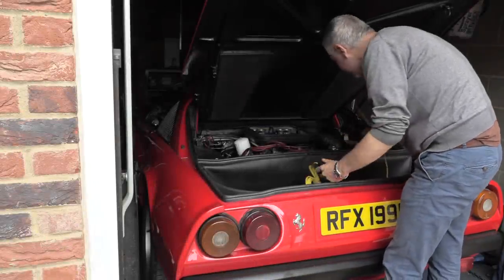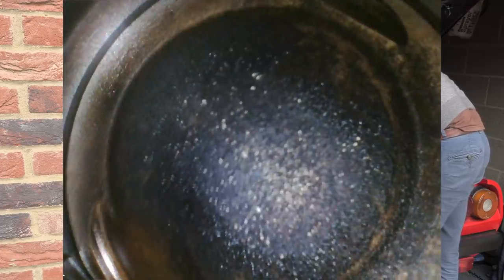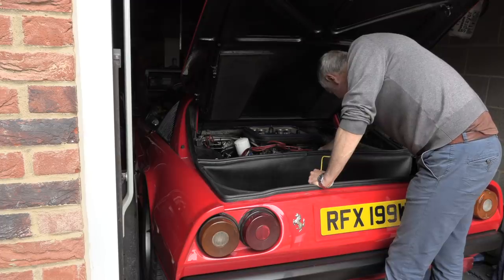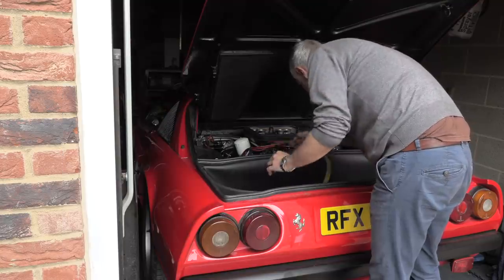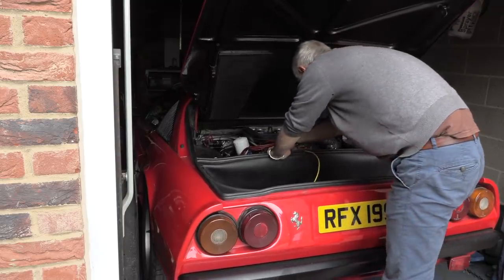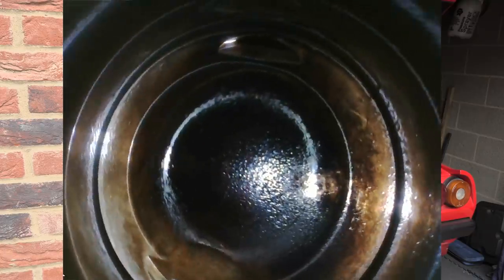See what this is showing as soon as possible now that we're back. I'm worried that it's too hot for the camera, but okay, so there's no oil there. That's cylinder three. Cylinder two. Now for cylinder four, let me bump the car forward a bit. Cylinder four, the top of it actually looks like it's got a sheen of oil. I think that's the worst cylinder, really.